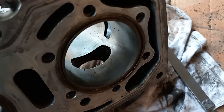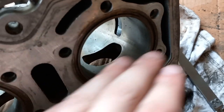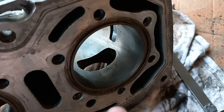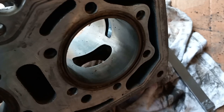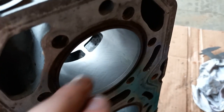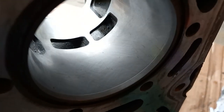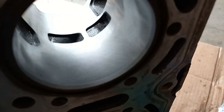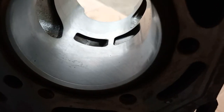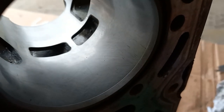You can see that right now we just have straight lines, so they're worn out. We're just going to take a little scotch bright and some WD-40 and scuff these up a little bit. It's very important that you don't overdo it, but you want enough so it'll hold the oil. If you do it right, the scratches will be at a forty-five degree angle — we'll go in this way first and then come back the other way. You won't be able to feel these scratches but you'll see them, and the oil will stick to the cylinder walls better. I've gone through with the scotch bright and rubbed the inside of the cylinders with some WD-40 and now cleaned it all out. You can see just barely this little X pattern in here — that's the crosshatching. It provides extra surface area for the oil to stick and you can get a better seal and better compression with a good crosshatching.